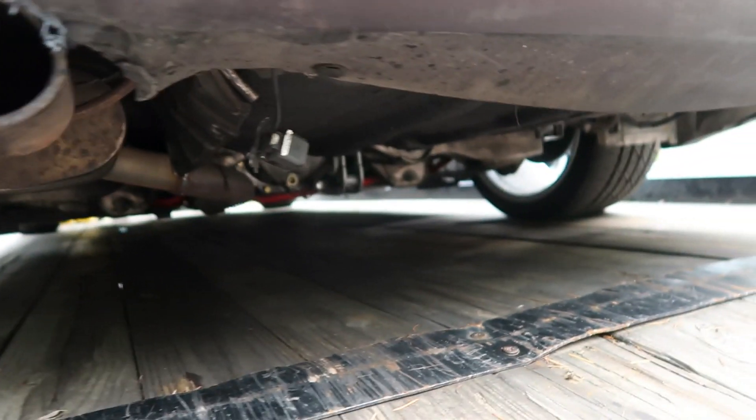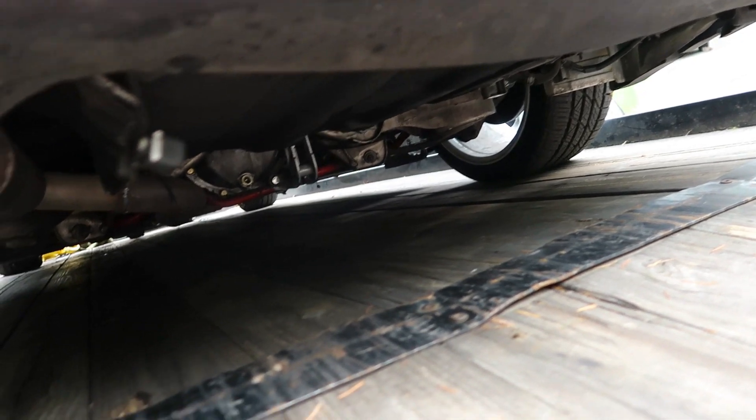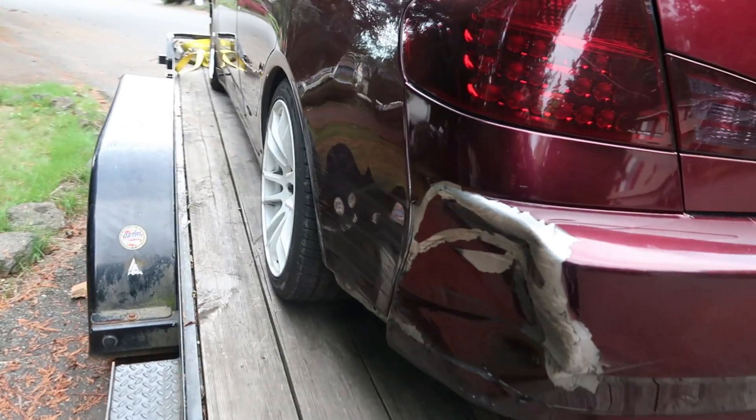There's the melted exhaust. Gabe — it was a last-minute quick exhaust fix. All my hangers are kinda just safety-wired throughout the underneath of the car, so it should be a little bit more stable than the rubber isolator mounts — the donut ring-looking things that usually hang the exhaust. Cause if I break that, we have other issues; other stuff in the car is probably broken. All the tires are aired up and we should be all good to go. I'm gonna go ahead and put this down, get this thing strapped up, and then do our final checks on the trailer.